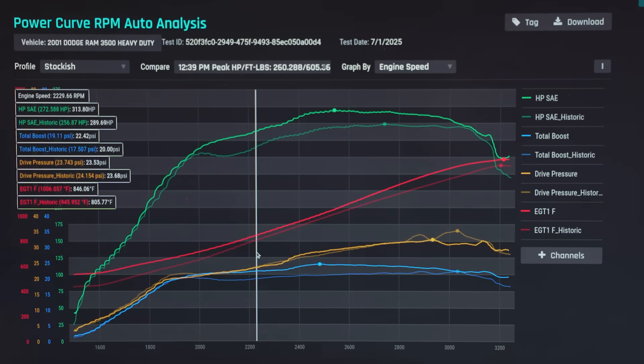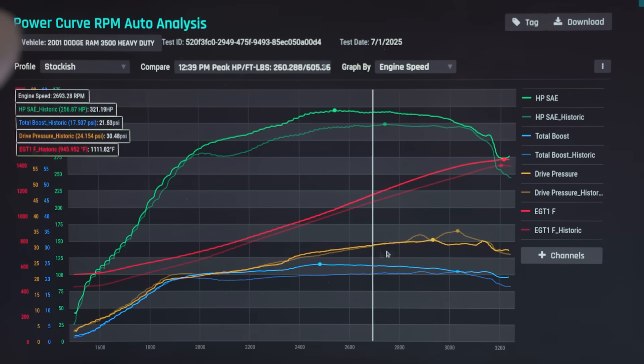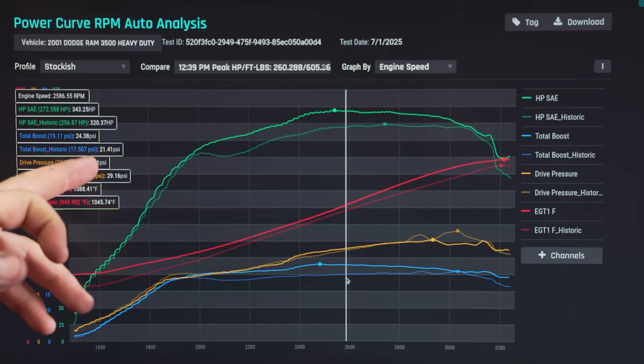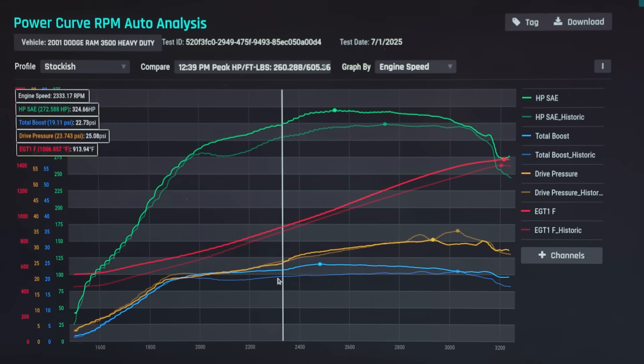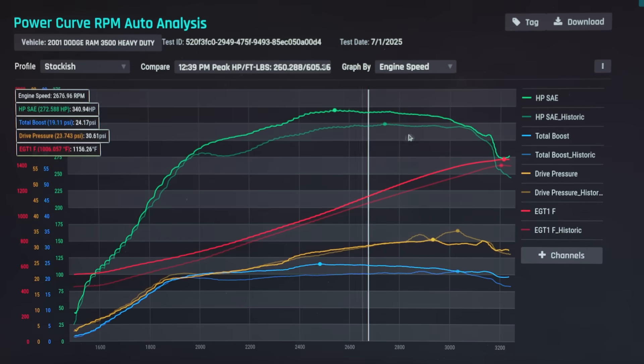Comparing here: stock HY35 to stock HX35 — it's actually a lot more meaty through the run. That's actually impressive, I didn't really expect this. Drive pressure was basically the same but boost was just considerably higher. At a plot point: 24.3 versus 21.4 — so we're just higher boost the whole way but drive pressure was the same. EGTs were a little warmer. We made more power through the run just because of that extra boost. I think we do one more run — apples to apples — we'll crank the gate on it, get that boost up like the HY35 was, and compare.